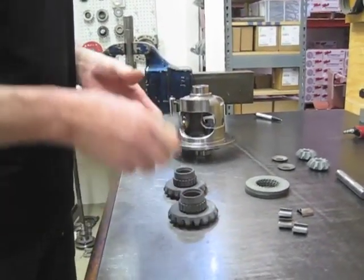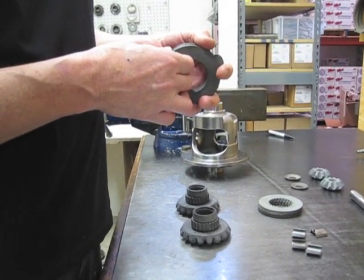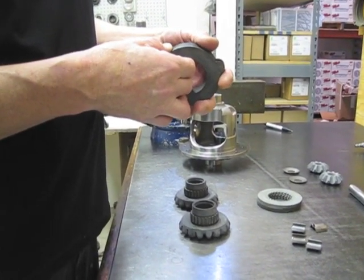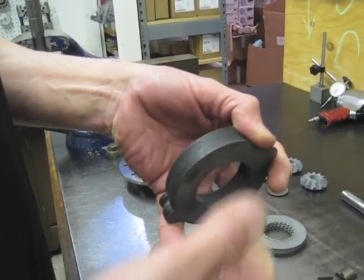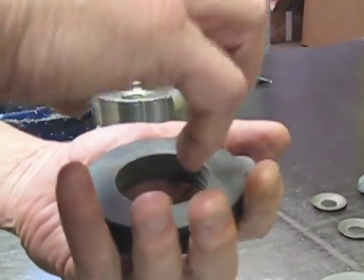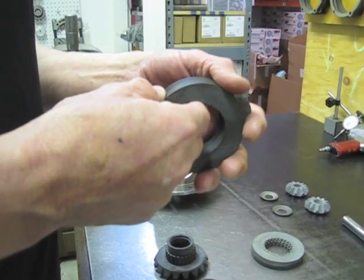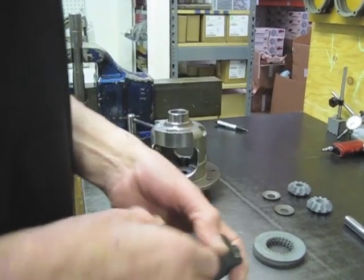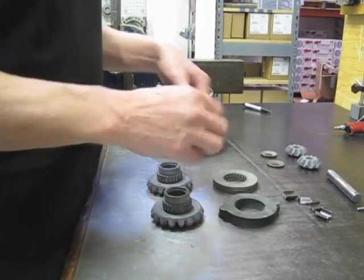One of the things that I always try to do here is to stack my clutches. There will be one side of the plates and discs that will have a nub slightly raised higher than the other side, and I always try to get the nubs facing down so that as you stack you'll have a nub against something that's fairly flat. You're going to have to look at your clutches real close to pick it out. It's kind of hard. Anyhow, you get your clutches stacked, all nubs facing down,